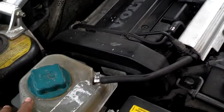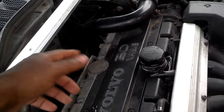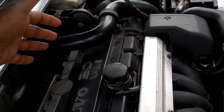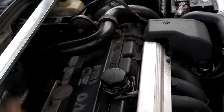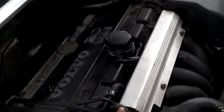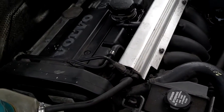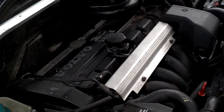When I went to fill up my coolant, one of the heater core lines going to the motor was leaking, so I had to pull some stuff back off, trim about a half inch off that hose, put it back together, and stop that leak. I also didn't tighten my fuel line down all the way with my wrench, so when I started the vehicle I had a fuel leak there.